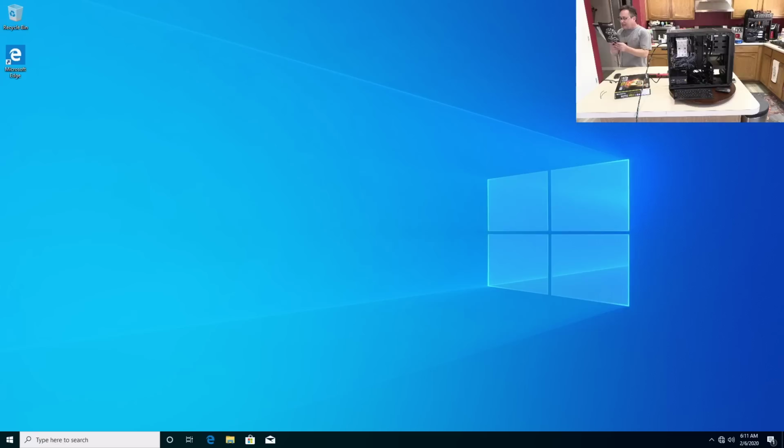Even when a game tries to support dual GPUs, the results often come up short. Two recent examples are Red Dead Redemption 2 and Star Wars Jedi Fallen Order. Using a Core i9-9900KS with a pair of RTX 2080 Ti cards and an NVLink connector, I gave both a shot at maxed out settings in 1440p and 4K. Average frame rates improved in Star Wars at 4K, but not at 1440p, and minimum frames per second did not. However, when playing the game, SLI caused massive stutters, sometimes lasting several seconds, and more frequently in combat, the worst time for that sort of behavior.